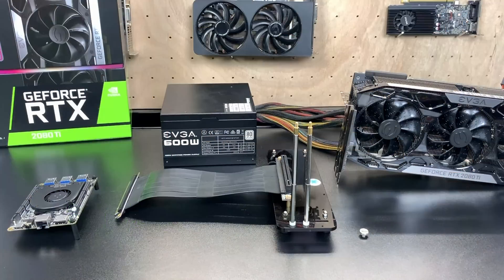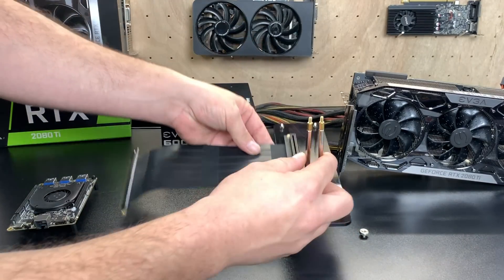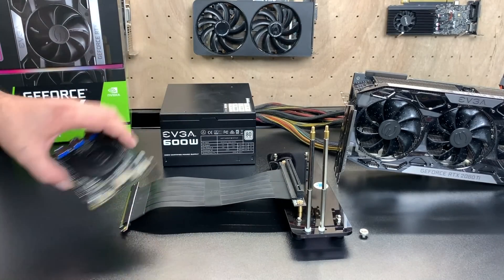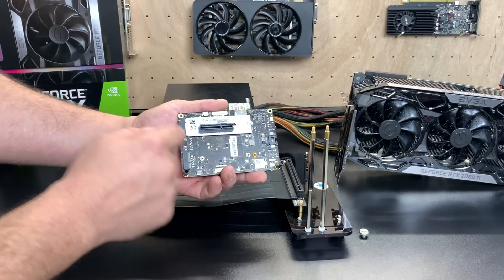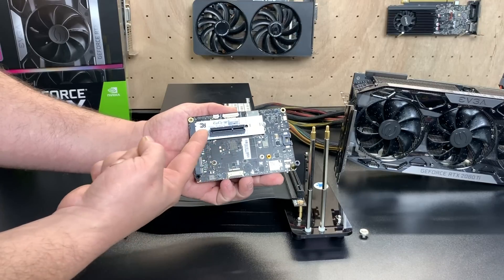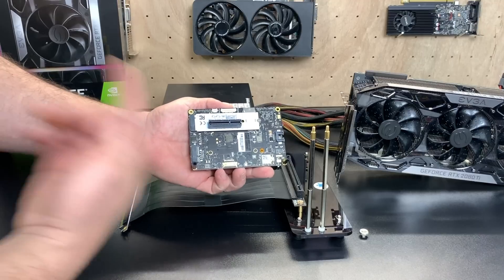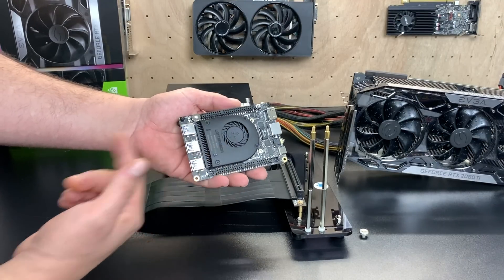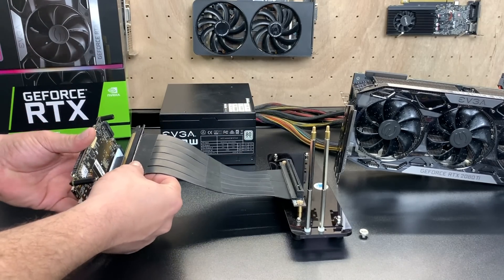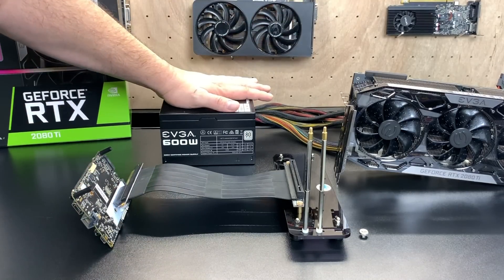Before I get started, I want to show you how I'm going to set everything up. I have a little PCI X16 riser adapter here. I actually had to modify it because this is a three-slot card, and this is only made for a two-slot GPU. It's got an X16 ribbon cable. The problem is the Latte Panda Alpha can only do PCIe X4 3.0 out using an M.2 adapter. So this is basically just going to plug right in. I have to add power with a mini Molex to the M.2 connector, and the card's not going to be running at its full potential because we're only going to be able to do X4 3.0 instead of X16 3.0. I'm also going to have to add power to the GPU and the Latte Panda's M.2 adapter.